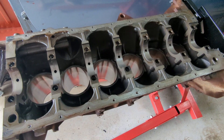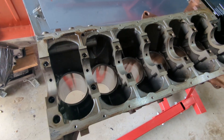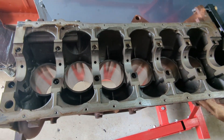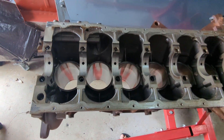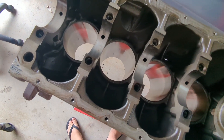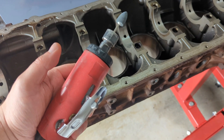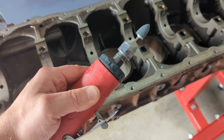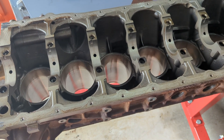It's a new day and we're back down to a bare block. I've taken the crank, caps, and girdle off. What we are going to be doing today is focusing on deburring this block — removing any casting flash or any sharp corners, which could be potential areas for cracks later on. I'll be using a number of tools to complete this job. I'll probably use this die grinder the most and use a file from time to time as well. I'll pop you on a timelapse so you can see how I go.